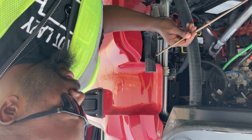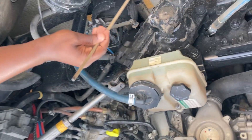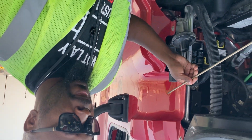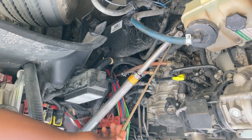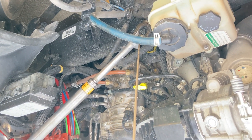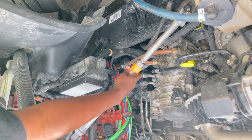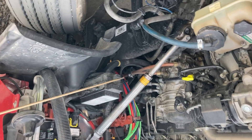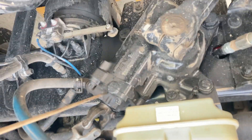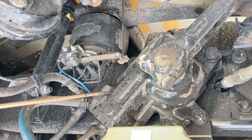We come into our steering column, which follows all the way down to our gearbox, and then into our steering linkage, completing the steering system. Our steering column is properly mounted with two U-joints that are present and tight. The U-joints themselves are not cracked, broken, or repair welded, and are properly lubricated. The steering column itself is not cracked, broken, or bent, and there's no more than a quarter inch of play from the center. We fall down into our power steering gearbox, which is properly mounted with nuts and bolts to the frame — mounting bolts present and tight — not cracked, broken, or leaking, and has no repair welds or illegal welds.